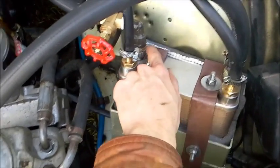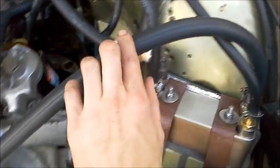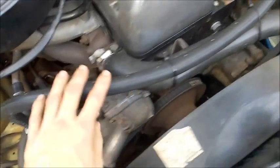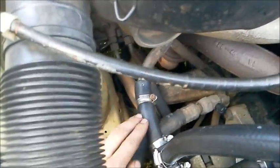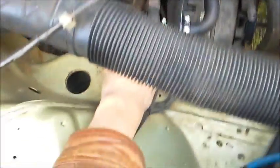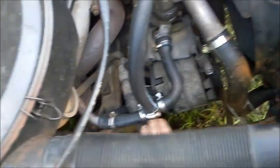This is the inlet for the hot water, and this is the outlet for the hot water. The outlet comes around, goes above the radiator tied in — I've got to get a better way of fastening that — and down into the return line which goes up into the water pump. This line here is the return for the heater cores for the heaters inside the car, and if you follow it out you can tell it follows here. So it's definitely the outlet and she's working pretty well.